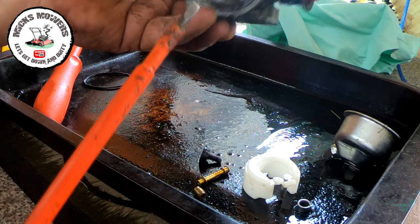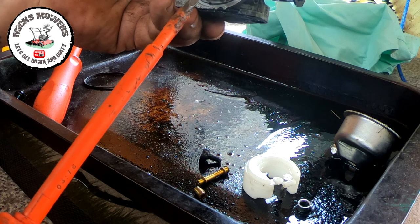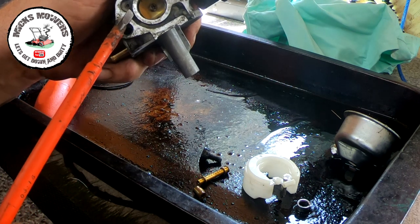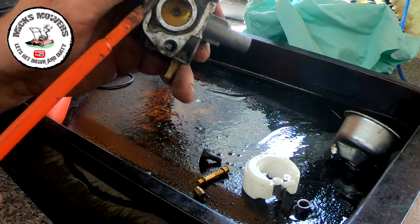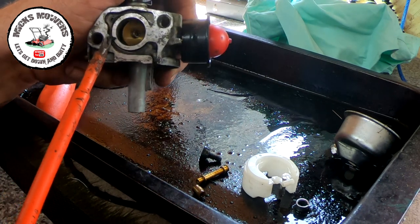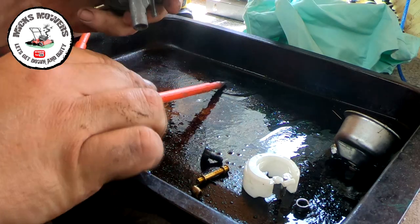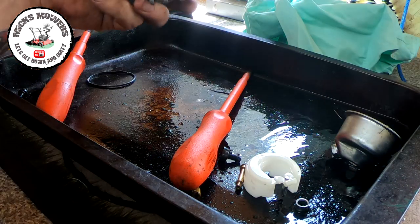So that's this slow jet, that went in there. We've got the main jet and the tube come out of there. We're going to blast this through with some WD-40. All this stuff in here - this is all carb cleaner, all in here. No wonder it's leaking - all this wants to be taken out and given a good all-round clean.